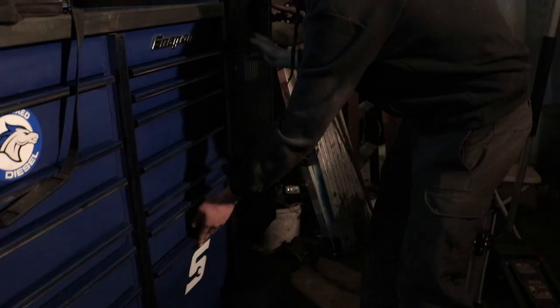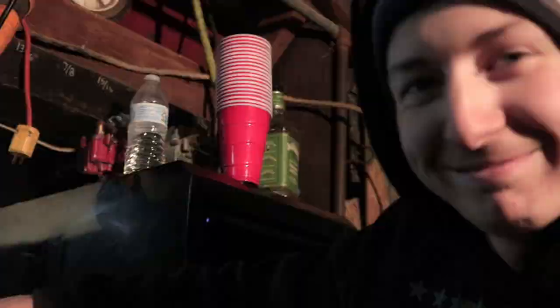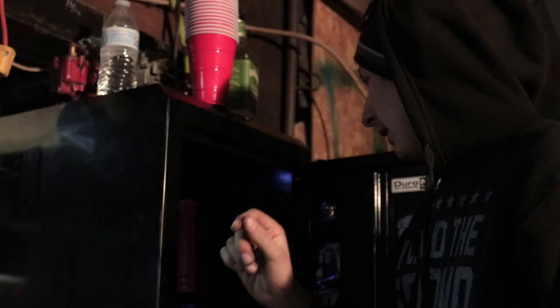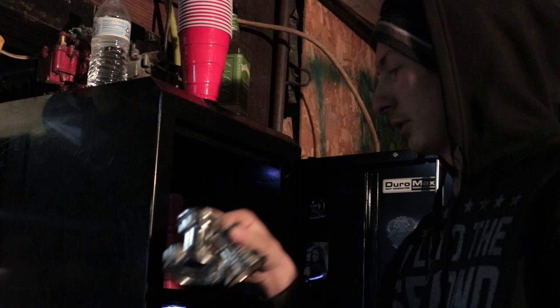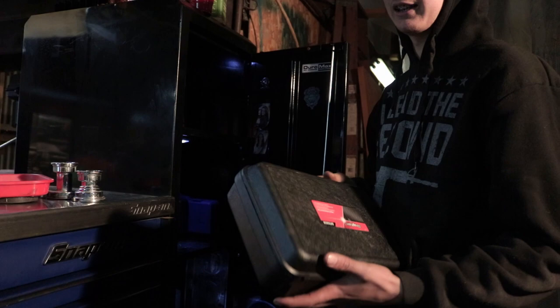And the locker — you got your magnets, trays, got to have them. My Harbor Freight locker. My Snap-on cup — this is a vintage Snap-on cup with women and cars. It's got some pins and random crap. Coolant pressure adapters — if you're going into any trade where you're going to be working on vehicles and you need to buy a coolant pressure tester, do not buy the cheap little hand pump one. It sucks trying to do it on a semi or a diesel. Buy the nice expensive Snap-on air pressure one. This thing is the cat's ass, but you gotta know how to use it — if not, you will backfill coolant into your gauge. As you can see, I've done it once — it's all fogged up from coolant being on the inside. It was a quick accident, I just wasn't paying attention.